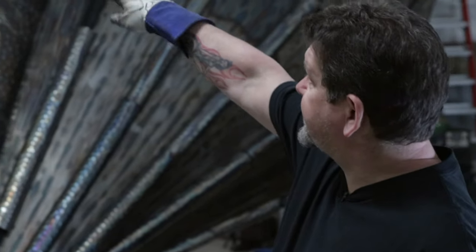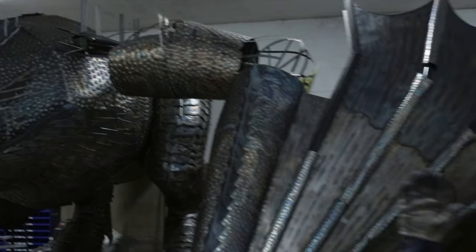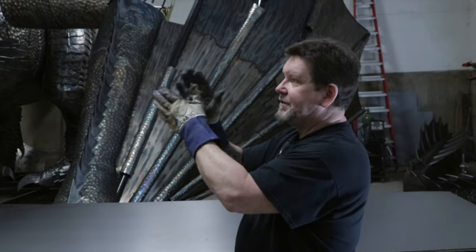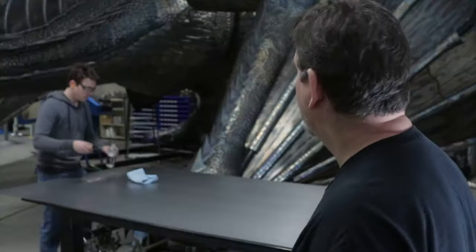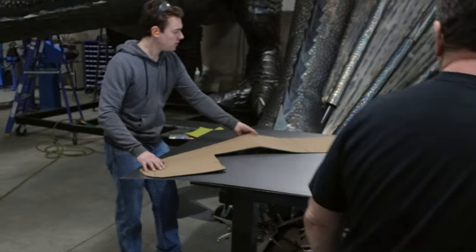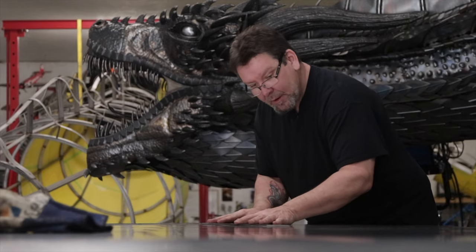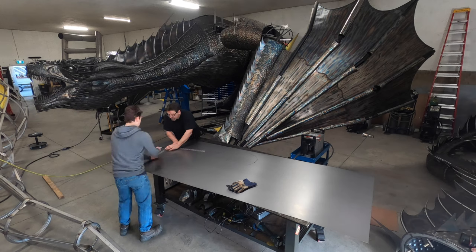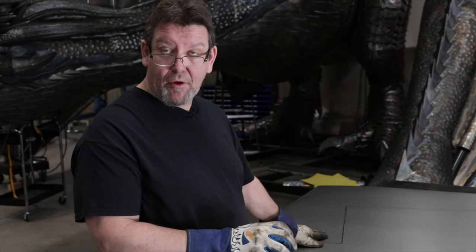Up on the shoulder where the two pieces of flat bar are joined all the way around, we're sandwiching the dividing point - making the dividers that will separate the fabrication to the body from the fabrication to the wings. That'll be the seam where the two meet. It's a little bigger job than I had anticipated once I started looking at it this morning. I started off making a cardboard template - it's easy to cut, easy to lay out - and then I can just trace it out on the clean piece of metal. The next step will be to cut all four pieces.